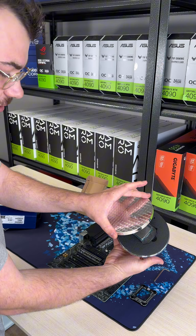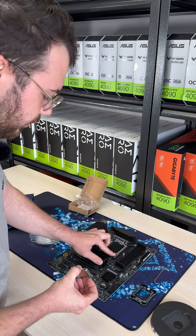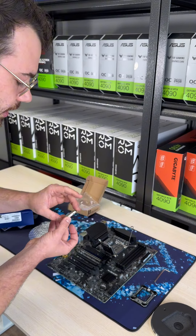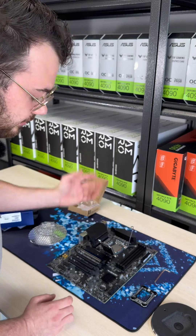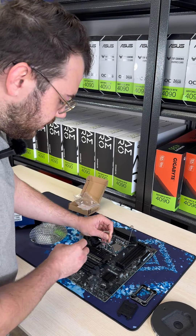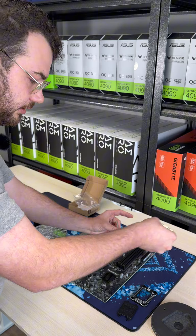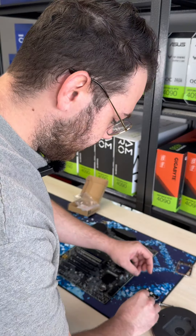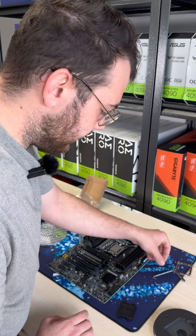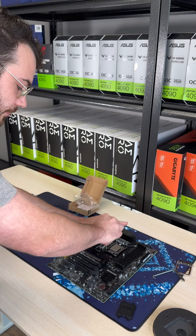I really like this Intel i9 — it has a little petri dish, it looks super cool. Open it up and let's put this in first before we remove the contact frame. You will see two little notches at the top and at the bottom — those will align perfectly with the motherboard. If you don't align it perfectly, you can bend some pins, which is very unfortunate because once you bend pins you can't RMA it and you can't return it. Next, we're going to remove the contact frame. I usually like to do one corner to the next and pop off this top piece. We will reuse these screws for the contact frame. I usually like to pre-put the screws into the contact frame before putting it down. Go ahead and lay it down, and now we can screw that on tight — doing corner to corner, starting top right, then bottom left, and making my way around.